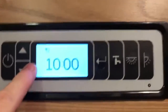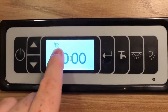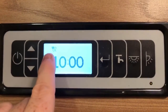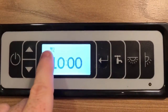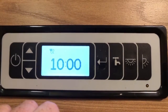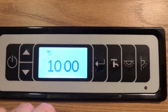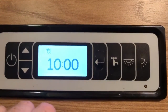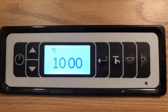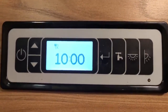On with the screens of information. The first screen here is going to have the time and then any other little symbols up here. This symbol at the moment is a little plug, which shows that we're plugged into mains electricity. You may see a picture of a battery, sometimes with a V in it and an underscore underneath — that means you have a low battery voltage. And you can also see what looks like a symbol for a beaker or water container with an arrow pointing down, indicating a low tank level. So those are some other supporting symbols you can get.